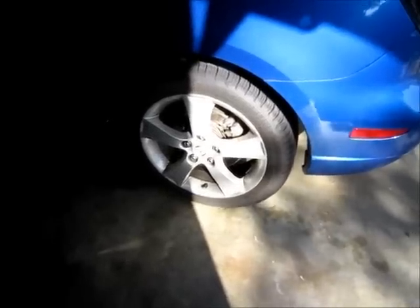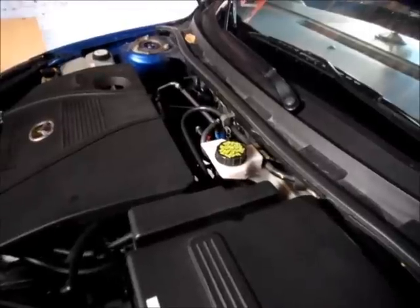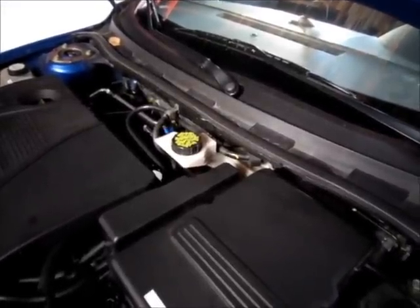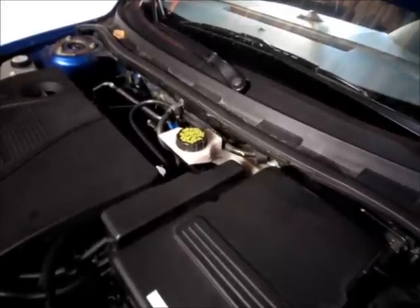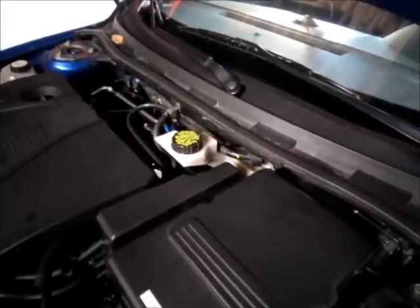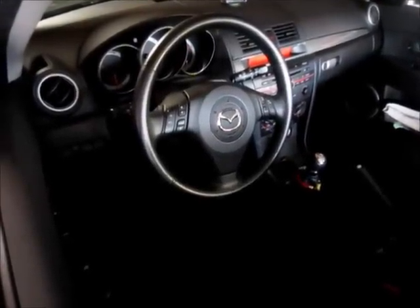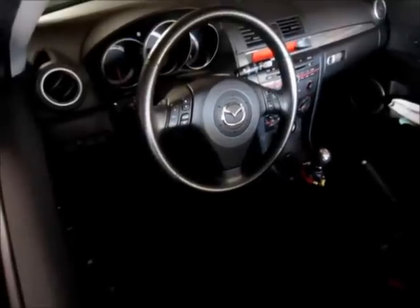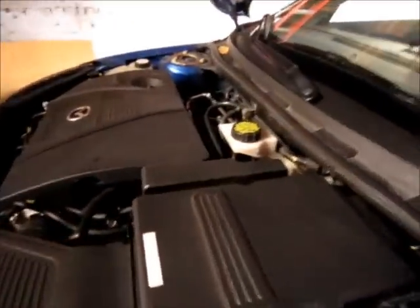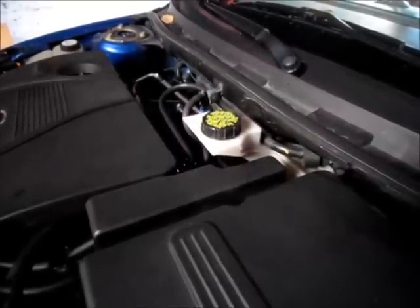Brakes are installed and wheels are back on. Two things left to do: tighten the cap on the brake reservoir. Mine did not overflow simply because I don't add brake fluid as my brakes wear down — I keep it at the minimum requirement but not up to the maximum. Therefore, when I put in the new pads and the pistons were compressed, there was still plenty of space in the reservoir. The last thing to do is turn on the car and pump the brake pedal until it's not feeling mushy anymore — that means you have hydraulic fluid in your system up to pressure. Then check your reservoir to make sure it's not at minimum and is closer to max. And that's it for doing the rear brake pads on a Mazda 3 2005 model.